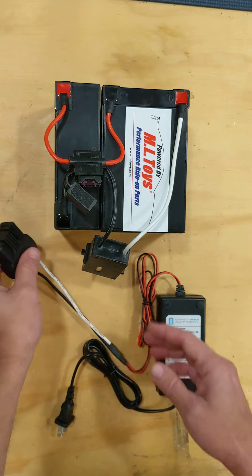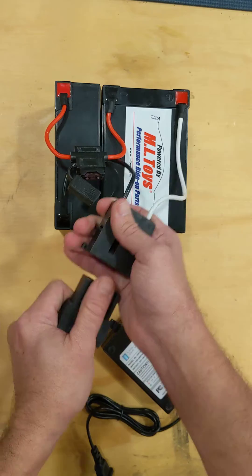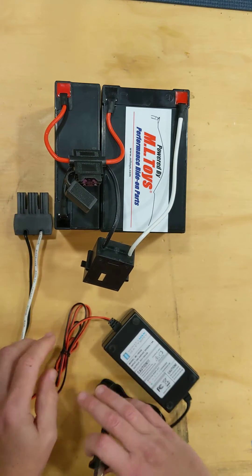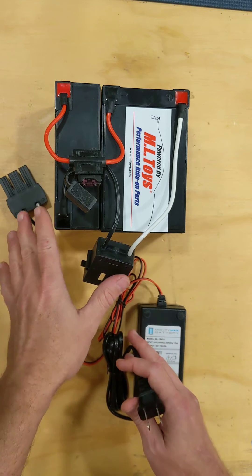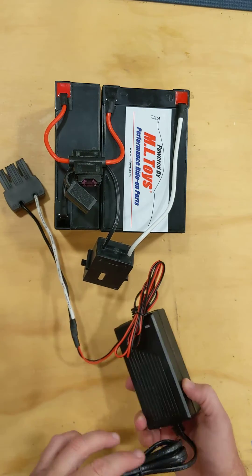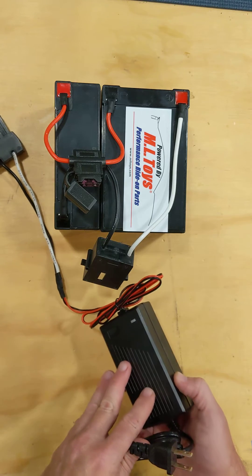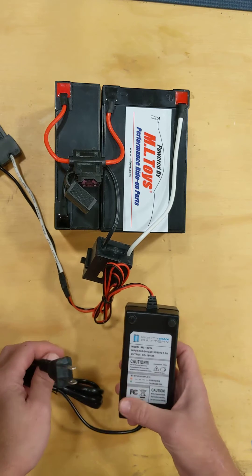Other than that, it's pretty simple. The connectors just plug in, just like they do on your vehicle, and they charge. One thing you want to make sure is you plug it into the wall first, and then into the battery. If you plug a charger into the battery first and then the wall, the charger may not start charging. The charger does have a circuit board in there, and it's doing some electronically secretive things.